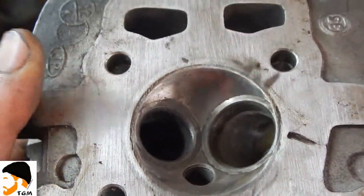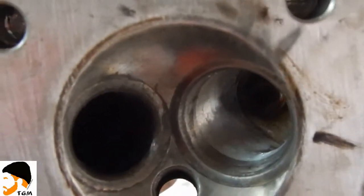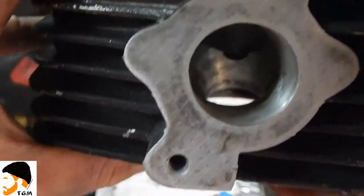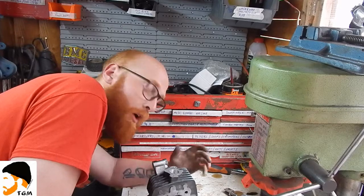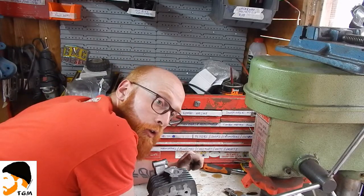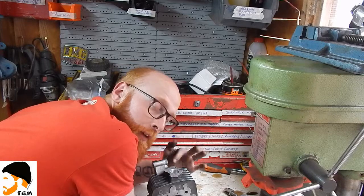As you can see I've been playing with the Dremel a little bit on the inlet side. The main thing we're going to do is take any harsh steps out in the transfer of flow. We want that to be as smooth as possible through there flow-wise, and still want this sort of texture going through it. We'll crack on with the measurements we need and hopefully get both sides done. I'm going to insert some photos of the before and after, essentially just trying to take out nasty casting marks and any obstructions that would cause restricted flow.